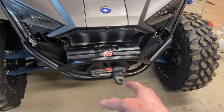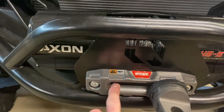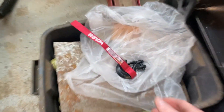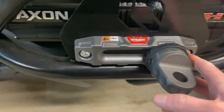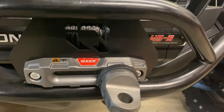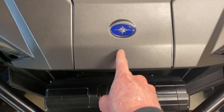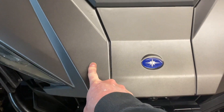Starting at the front — the winch. I went with a Factor 55 mainly because I didn't like how far the main hook stuck out and was afraid of that hook damaging the fairlead. It doesn't come with a bump stop, so you end up with a cotter that could spin around and poke into the front of the fairlead. I already had all the utilities for this — basically a strap and a shackle through the hole. Also, if you're putting in a camera, make sure you run the camera wire through the plastic plate piece behind it — your connector will be right in there and you have to pry it up a little to reach it.